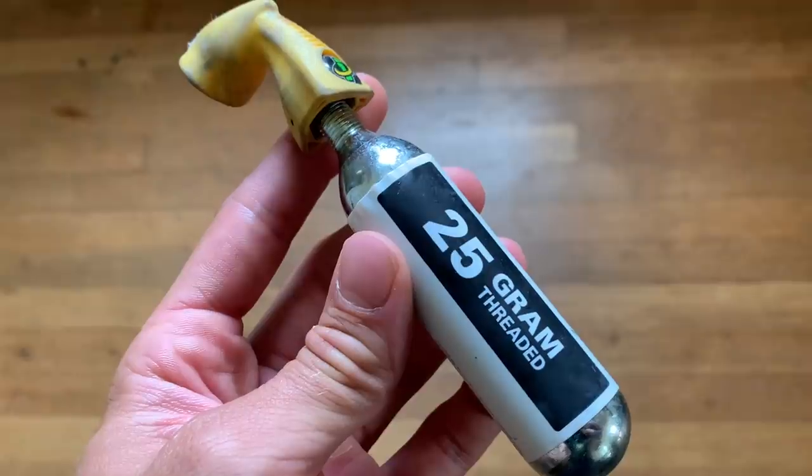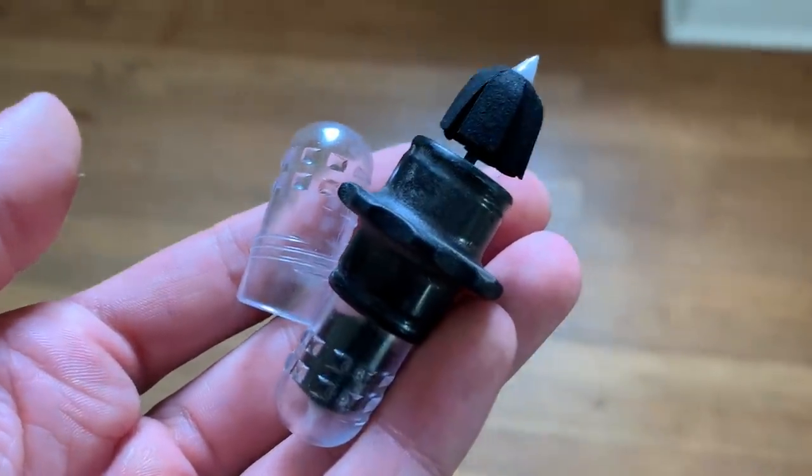I also carried a small lightweight multi-tool, a 25 gram CO2, and a Stans dart plug in case of a puncture. Notice how I didn't say tube — that's because for this race I actually didn't carry one. Finally, something I can agree with you on. If I get a flat, I just ask my riding buddies for a tube. Saddlebags are so not pro. Given the strength of the field, if I were to get a flat that I couldn't fix with a plug and had to put a tube in, then I'd already be out of contention for a high placing. Not to mention that if you do have to put a tube in during a gravel race, your chances of getting another flat skyrocket. I talked to multiple people after the race who got one flat and then continued to get many more flats throughout the day as they pinched their tubes. So if your tire plug doesn't work and you have to put a tube in, make sure to put a lot of pressure in there or else you could be looking at a long day on the bike. And don't get me wrong — I wouldn't pull out of the race if I got a flat. I'd do my best to get to the finish. Pulling out is always the last resort.